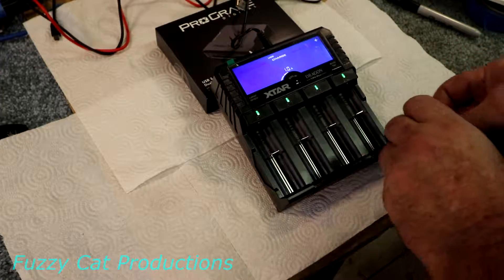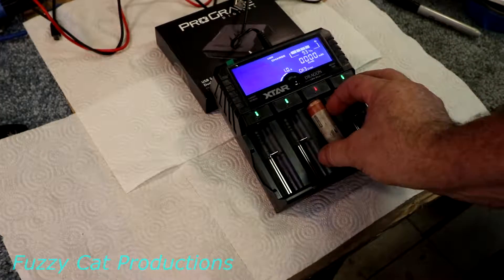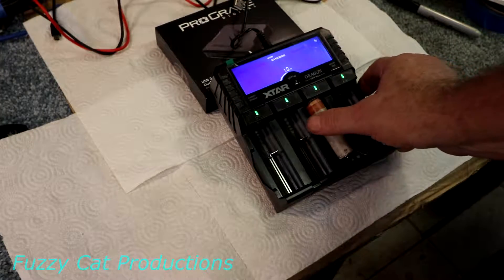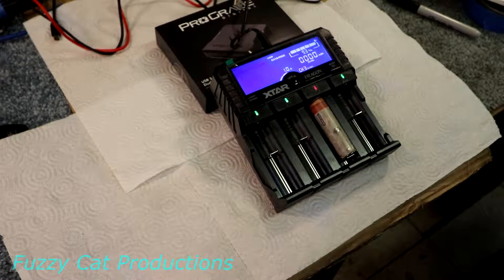Sometimes I have a little trouble putting the battery in. It starts charging but if it gets bumped or moved off center a little bit, I have to wiggle it around until it makes contact again — that could have been a bit better considering the price. But one pretty cool feature I didn't really expect: you can mix and match battery types. You can put a nickel cadmium, a nickel hydride, or a lithium-ion battery all in there and they'll charge independently because each bay has its own independent circuit. That is cool.